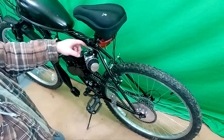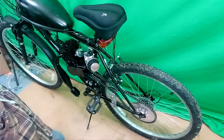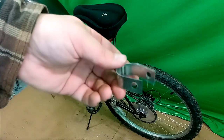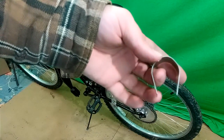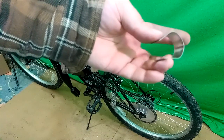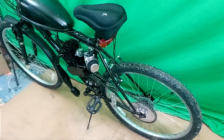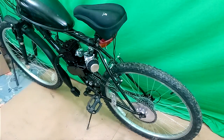Now we can turn this in the direction for the throttle, unless we want to make the throttle wrap around and come back. It probably should turn this way. We want to attach this to the seat post so it doesn't bounce up and down or move back and forth. This little metal piece that came in the kit — it comes flat and you bend it and put it around the seat post — you might put some rubber in between. But I'm not supposed to put this carburetor on here until the engine is broken in, so I'm not going to be finishing this installation at this time.